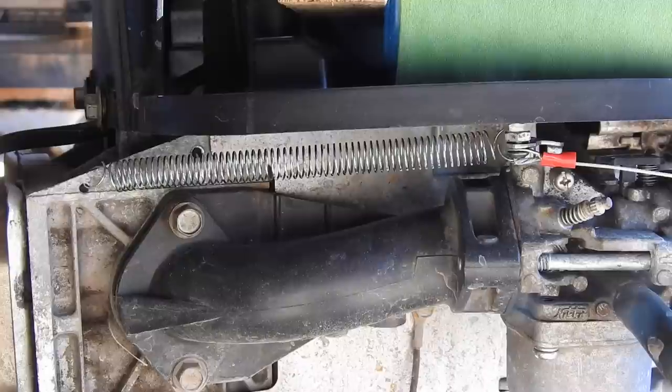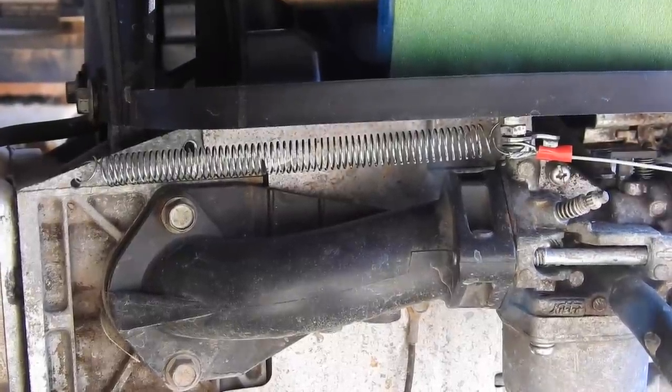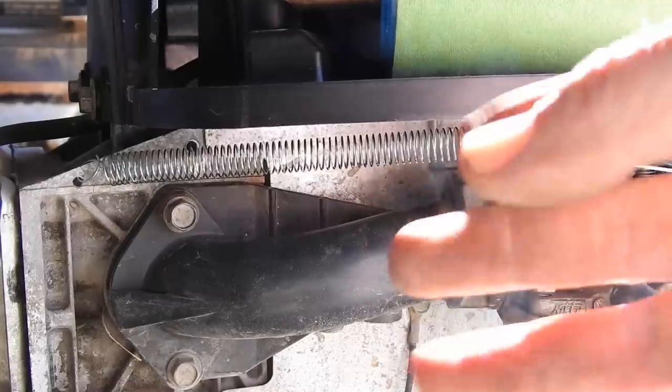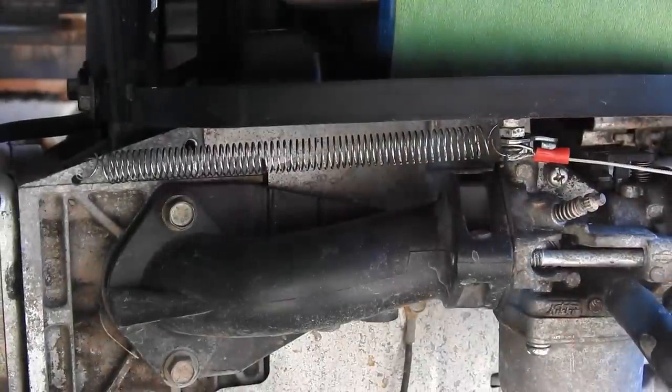Do that during a speed run. So I was having a little bit of throttle sticking wide open issue, and that's not good on something this sketchy. Anyway, the cable and the spring was having a little bit of a fight, so I cut the cable off. Then I drilled a new hole and extended the spring. It has a little more tension.